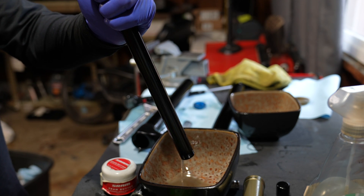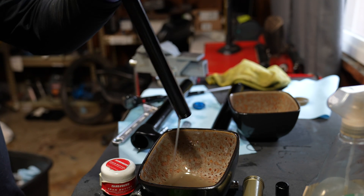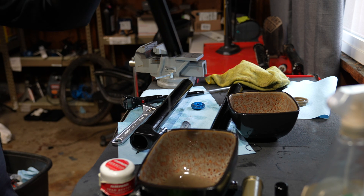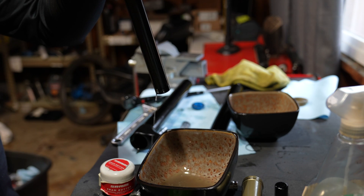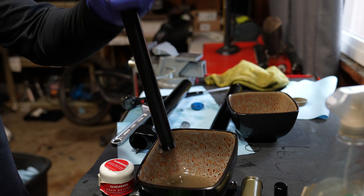Take the lower rebound rod and pump it until the damper tube is completely empty of the old damper oil. Checking the damper oil here — it's in pretty good condition, just like the lower leg fluid. The lower leg fluid can tell you if you need a damper service.